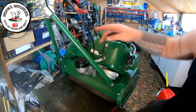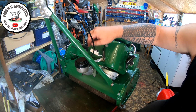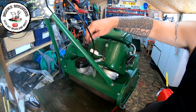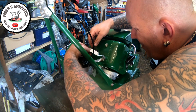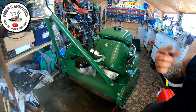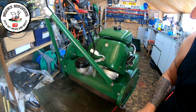So that's good. All I have got to do on here is put this little tiny piece of rubber on here so I don't get an electric shock. Sometimes if you're a bit sweaty, you get a shock off of that. I put the plug in, and the plug I've got is an NGK B6HS. So that all now should work as it should do. HT can now go back on, like so. I'm going to spin the machine round now and try and fit the side cover. Do a bit of greasing up and oiling up round there, and I'll come back in two ticks.